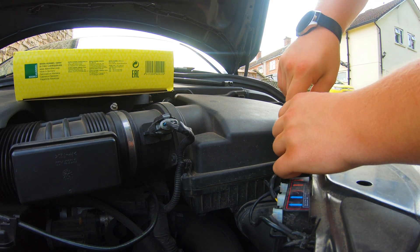It's tempting to buy really cheap filters, but essentially what they do is they allow more rubbish into the engine. You can buy high-performance K&N filters and they're good; however, they require maintenance — you can't just replace them, they're more expensive, and actually in the long run they let more rubbish through into your car because they're less restrictive. And they can clog up mass airflow sensors, causing engine lights, etc. So just bear that in mind if you're considering a performance air filter.